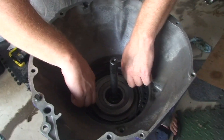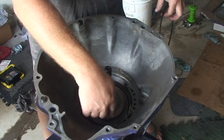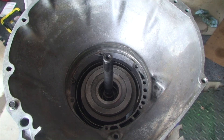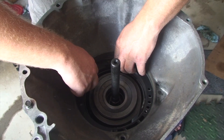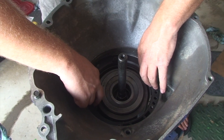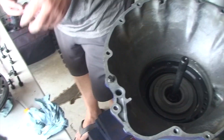You're going to have a new gasket — it's paper and it's got all these holes. You're going to have to figure out exactly how to align it up. Inside the transmission case you can see all these holes and rectangles, which is how the fluid flows from the case to the pump. There's really only one way it goes, so get it lined up nice and good. You'll have a small opportunity to tweak it, but the better you get it fit early, the better off you are.